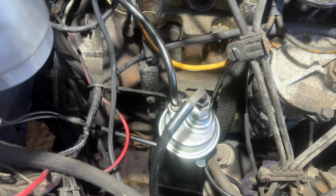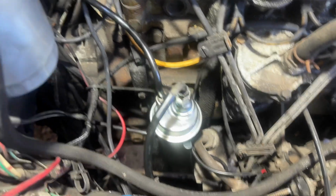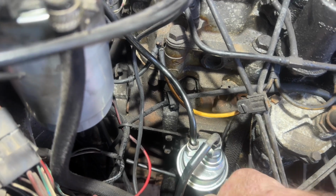That's the two pipes put back on. So all we need to do now is check that that little bleed nipple's loose, which it is. Sorry about the flicker, I'll turn that down, there we go. Now all we need to do, hopefully, is just pump this, and we should, in theory, get some fuel through. 2 hours later.